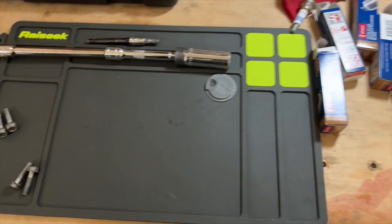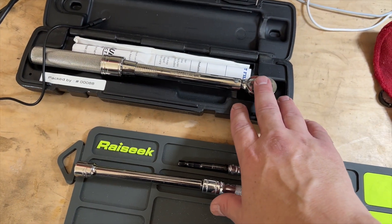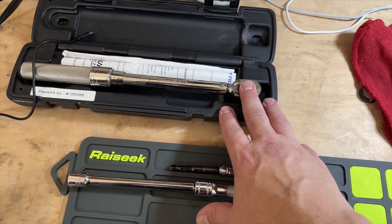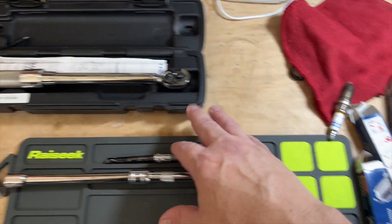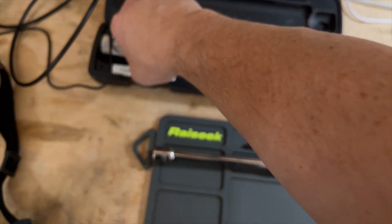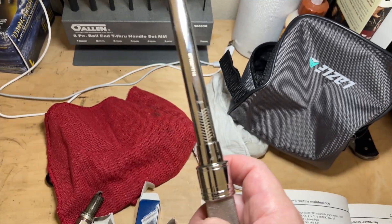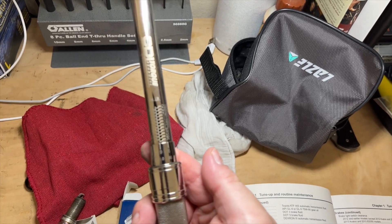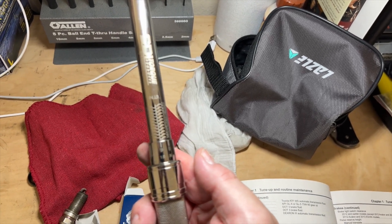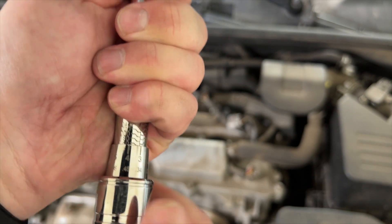All right, top side. Got my spark plug wrench. I need to get the torque spec. I have my smaller torque wrench — it's much more precise than my larger digital one that I normally use for wheel lugs. So, spark plugs, four-cylinder: 168 inch-pounds. This one has newton meters on that side and inch-pounds on this side, so let me set that real quick. Currently at 160, we'll go to 168 here.